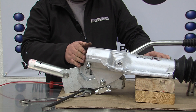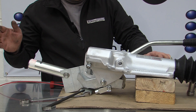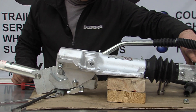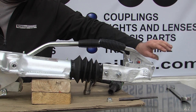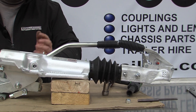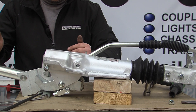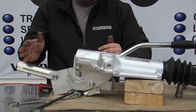If there isn't enough room to remove the damper from the back of the coupling to change it, undo the additional bolt on the head and slide the damper out the front of the jaw tube. It can be slid back in from the front without removing the coupling. It is very rare that there's anything in the way, but it can happen on some trailers.